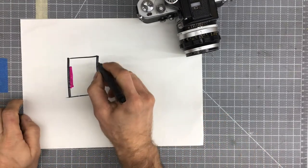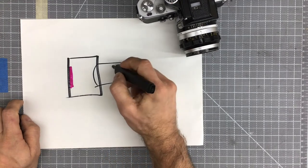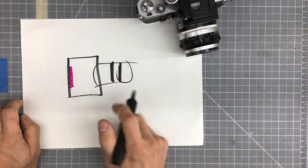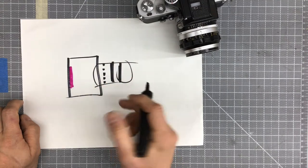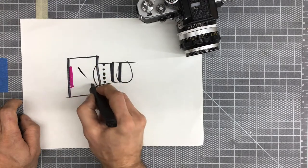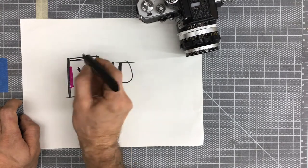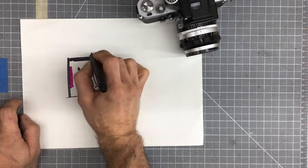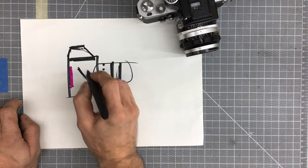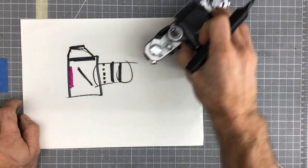Now, hanging off the front of the camera, we've got this really great looking lens, and inside the lens are, well, lenses. So imagine shaped pieces of glass up there in the front of the lens, but also an aperture, which is sort of an opening and closing wall. So you've got two things going on out there, but then you've got this angled piece of glass, that's your reflex mirror, and your ground glass, which is hiding right here in the plane, and then something roughly shaped like a triangle on the top here, stored inside of that little triangular mounting on the top of your camera, is what's called a pentaprism.